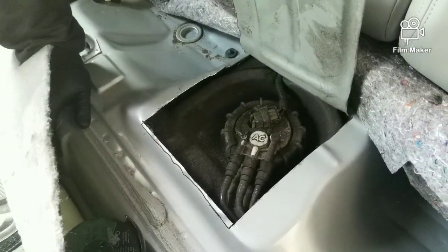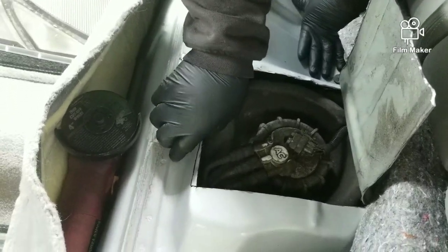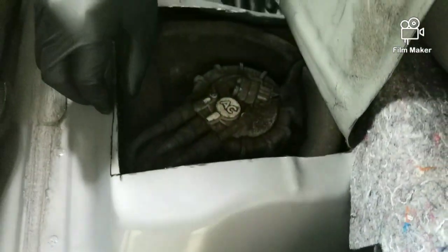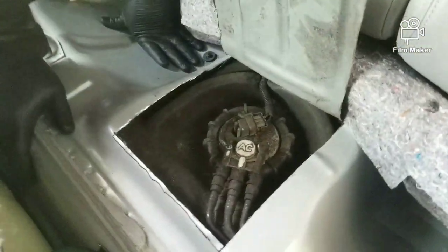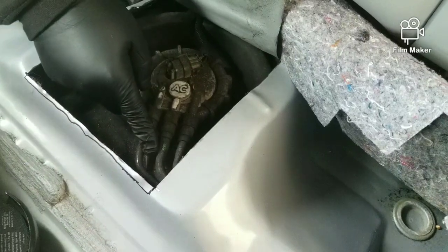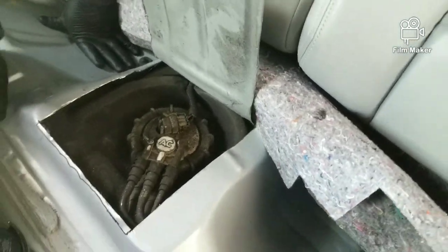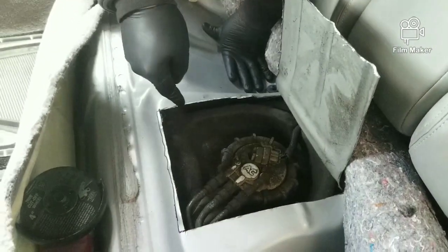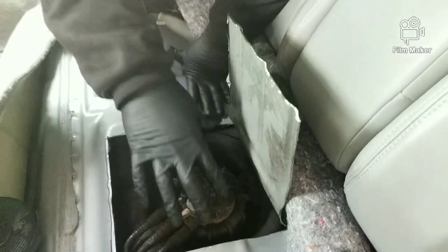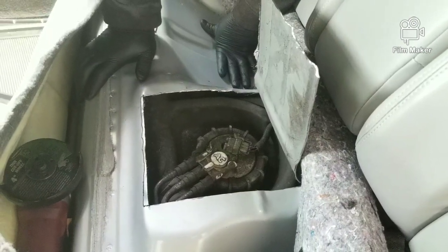Like I said, I cut this access hole here. What I ended up doing was cutting about an eight-by-nine inch opening, basically following around this ridge right here. You don't have to cut that much because this sheet metal is really thin, so you've got to be careful on these edges. I don't really recommend doing it unless you know what you're doing, because you don't want to cut your gas lines or cut a wire connector back here. I cut eight inches across going one way and nine going the other way, then just rolled and flipped this up to give me just enough room to do what I needed to do.